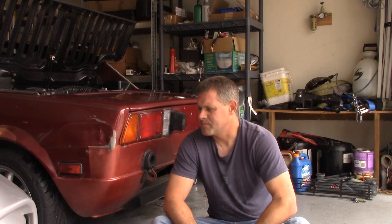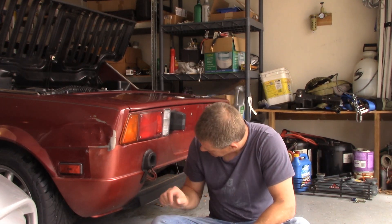I did run into one issue while I was out driving — it actually shut me down for the rest of the night. My Allison exhaust broke again. I've had this exhaust for a couple of years now, I'd say less than 10,000 miles on it. The problem I was having with it in the first place was this boom around 3,000–4,000 RPM — it's the best muffler they have to offer but it's really loud right at the sweet spot when you're out on the highway. I wear earplugs, and I finally got around to trying a supertrap muffler which worked great — I'll show it to you.